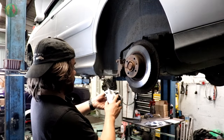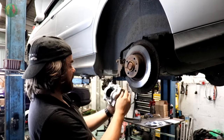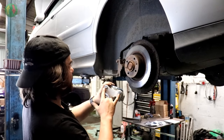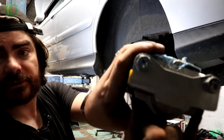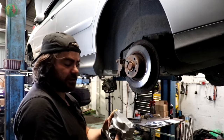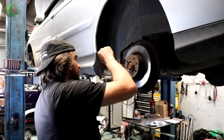So that will go on here. These bolts in here, I originally thought these were part of the kit, but this is really a bit dodgy. They should tell people this, because it might not be obvious that that's not the right part. That's only a 4.8 tensile bolt. Look, here, there we go. Basically, that's good for beds and wardrobes and things like that. It's not good for brakes, so those are not suitable to use in there.